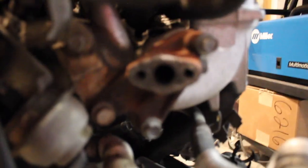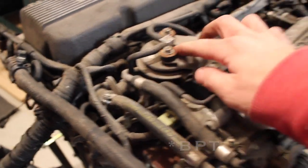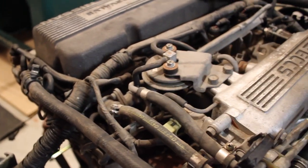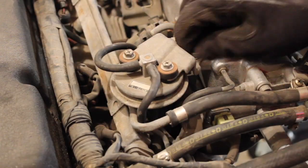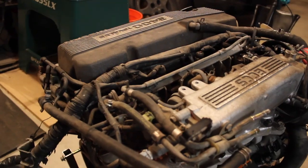We're going to have to plug this hole — we'll get to that later. And we're also going to have to cover this right here. The next one is the BPT valve, okay right here — two bolts, two vacuum lines, very simple. Boom, second one done. Look at that, already looks better.